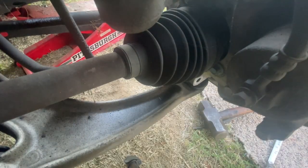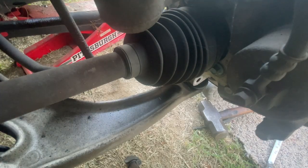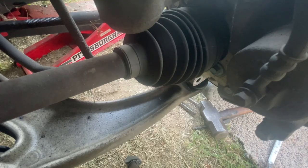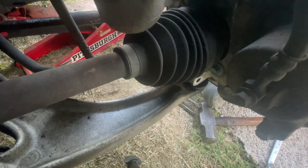In normal circumstances you should never have to touch the center nut in the hub for your axle. However, because this car has already proven to be a Malapu — that's why I call it that — we're going to loosen the nut up on the axle shaft so this whole strut assembly can move, preventing the axle from coming out if the thing wants to go sideways after the lower control arm comes out. We're not taking the nut off, just loosening it to where this whole thing has room to move around.